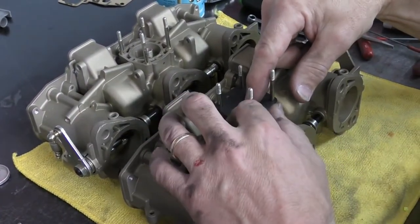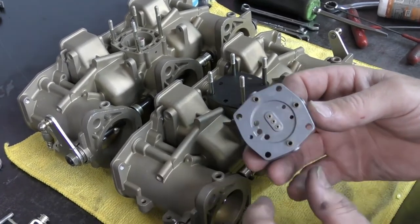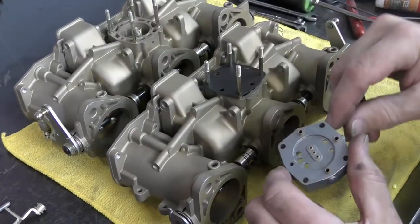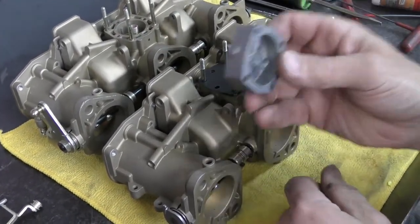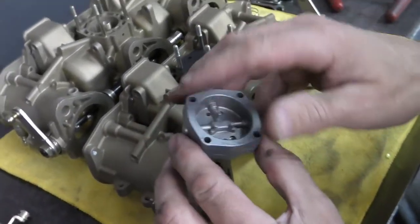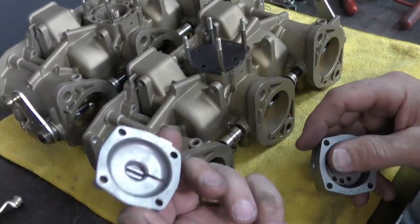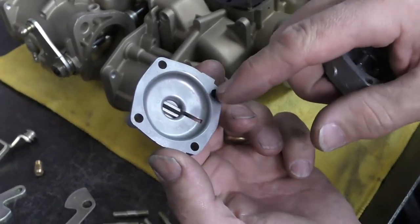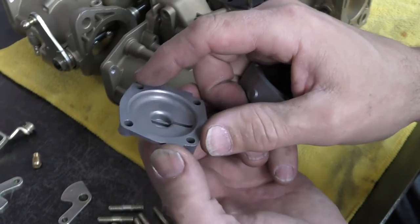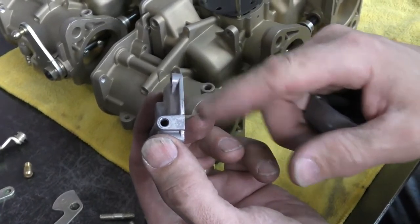You want to look and see that these holes are going to sort of line up. There are small guide plate holes right here that need to be able to push in — that's to make sure the fuel travels through the body smoothly. Now before we install these and the top plate, these don't suffer too much from distortion, but I always make sure they're flat. The faces will distort quite a bit and you'll end up with these bolt hole points — people will tend to over-tighten them when they start to leak, and what will happen is it will bow that surface, so we need to make sure this is flat.